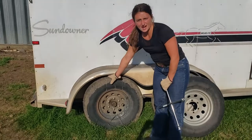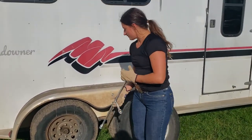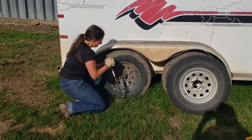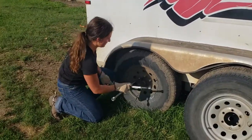So here's my spare tire. I had to put it on because I got a nail in my good tire. First off, you want to start before putting this tire up off the ground — you want to go ahead and loosen up the bolts as your first step. Otherwise, you won't be able to get them when the tire can spin away from you.